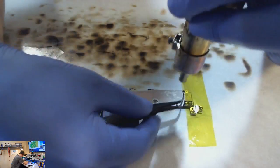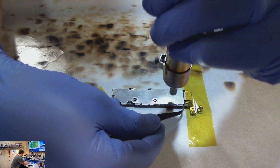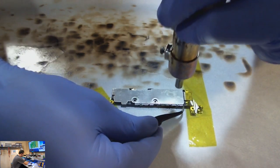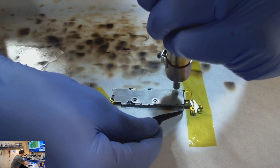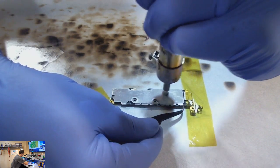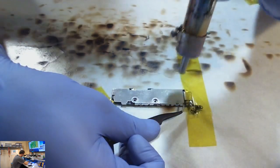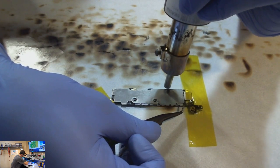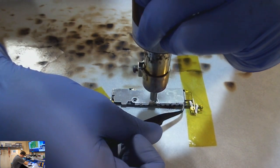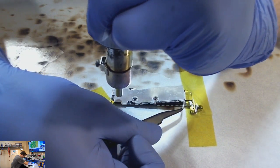We're almost up to temp at about 350C. I'm going to start torching this thing. I'm not putting any real pressure lifting up on it - I'm more testing the water, waiting to hear the little clicky click these things make when they start letting go. I'm giving it just the slightest little bit of pressure - not prying by any means, just lightly lifting. I notice this is only like my second iPhone SE. It's considerably different the way the heating feels here compared to a 5S or 5C.